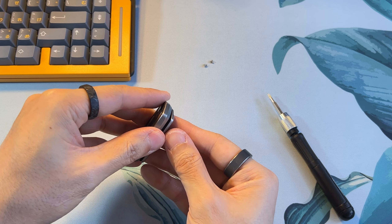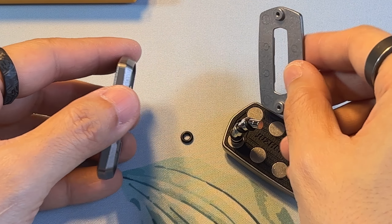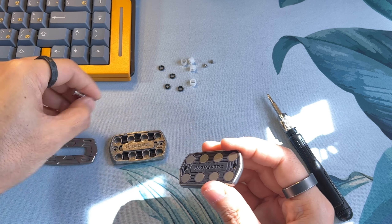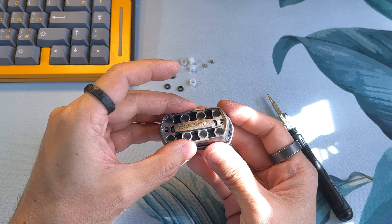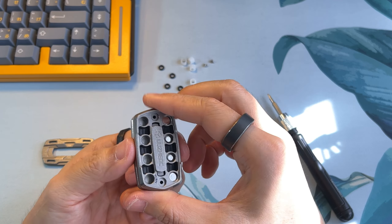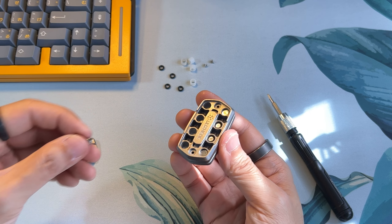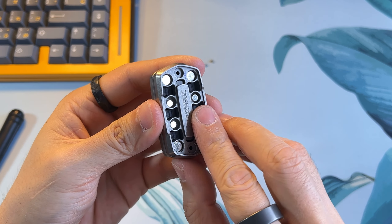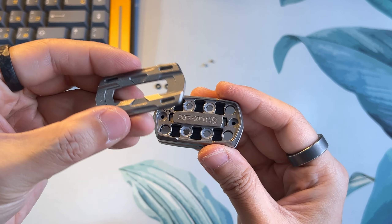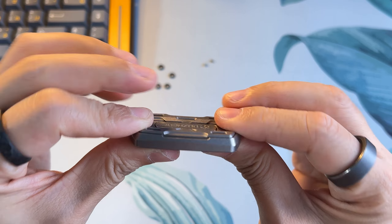Tinkering around with the Tenor was quite a frustrating experience with the magnets and spacers flying everywhere, but I found a pretty good method that greatly reduces the possibility of flying magnets: use one half to hold the magnets in place while replacing or reconfiguring the magnets on the half you're working on. Make sure you have the orientation of your magnets correct by first stacking all your magnets together so you won't forget the polarity, then insert them one by one. Only insert the nylon spacers for the smaller magnets once you're done with placement, because they tend to fall out. Once done, place the cover back on, split the two halves while holding the cover in place, and install the Torx screws back.